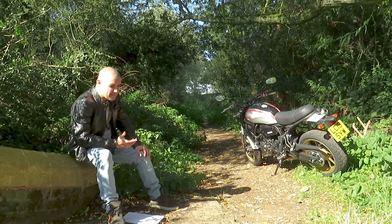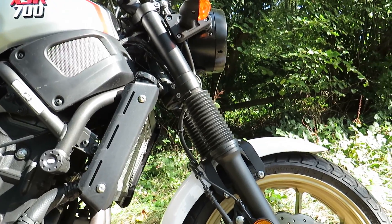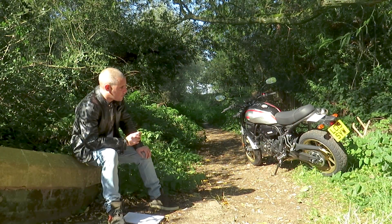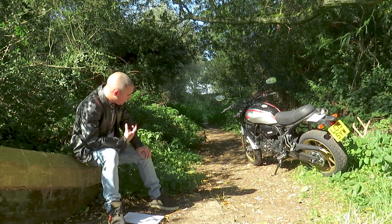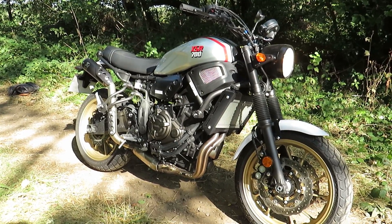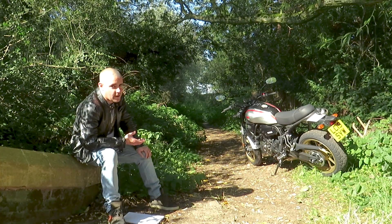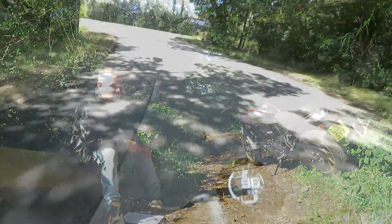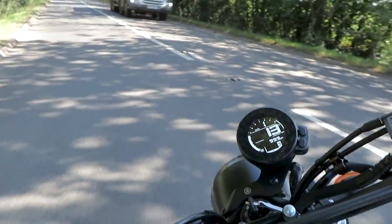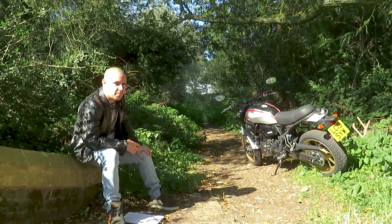It's a very simple, back-to-basics braking system — there's no IMU, just ABS, and it's not switchable. It's not too intrusive though, which is quite nice. You do hear the front tires chirp a little bit as the knobbles on the tires move around under really hard braking. You've got a Yamaha blue-spot style brake caliper on the front — I think it's a Sumitomo item — with a 282mm disc, and there's a single two-piston sliding caliper, a Nissin unit, on the rear.